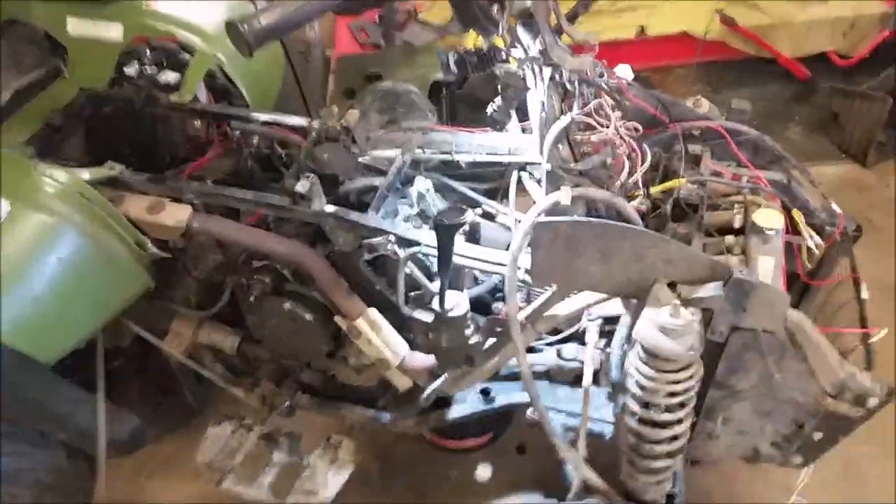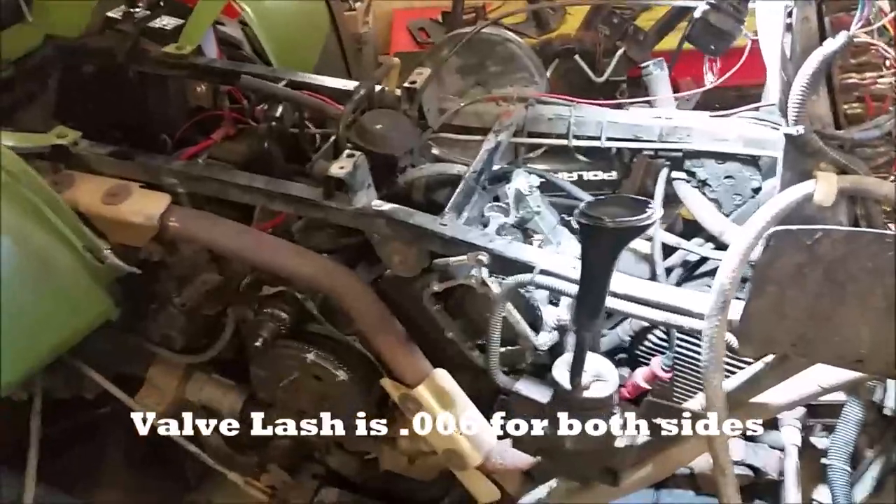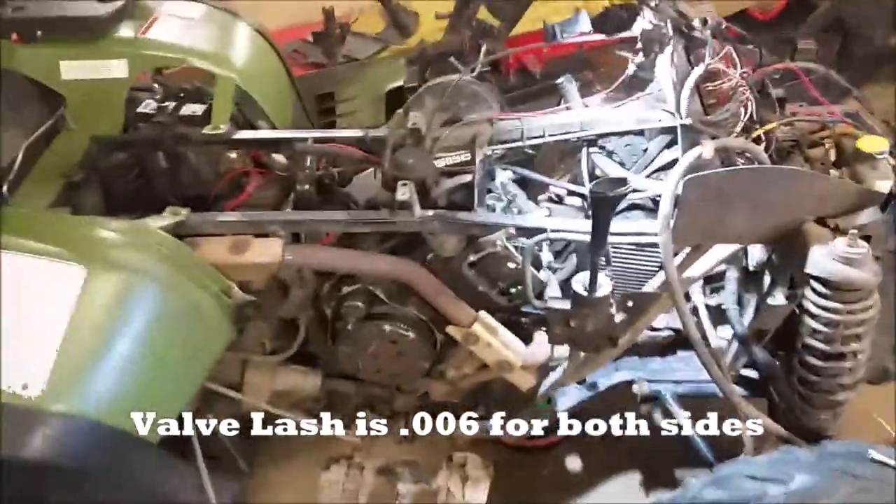Have you seen how I've done that? Basically you do the opposite of what I showed you, except for one thing. When you put the rockers back in — if your rockers are installed — double check that you're still at top dead center. Check your valve clearances; I have to research that — look that up and find out.